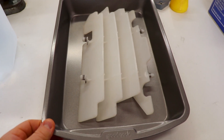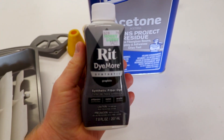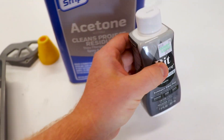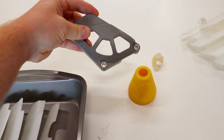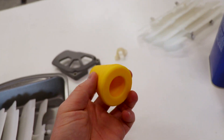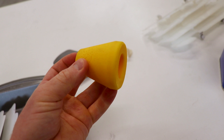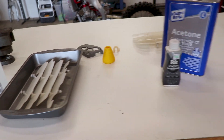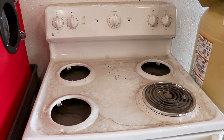We're gonna need a pan or pot that the parts will fit in, some acetone, and the dye — it's called RIT Dye More. We're gonna be doing black on these parts. The parts I'll be doing are the radiator guards, front sprocket cover, brake line guide, and just for the heck of it I'm gonna try to do the shock bumper. It's made of dense rubber — not sure if it'll accept the dye, but that yellow color has got to go.